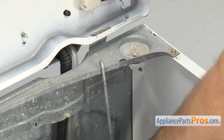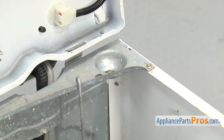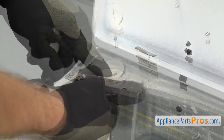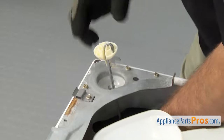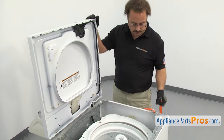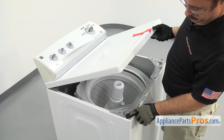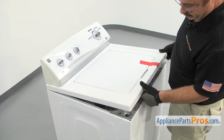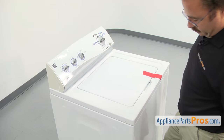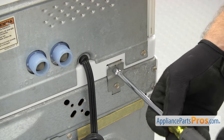On the rear one, you want to hook the rod onto the frame right here because the tub has to be supported when we lay the washer on its back. Now we're going to lower the top down. We're going to take the lanyard out, then you can lower it down. As you lower it down, you want to make sure that these tabs here go into the slots in the top. Then you can pull it forward so it drops down and push it back to lock it in. Once you have it locked in, we can go around back. We're going to use a quarter inch nut driver to put in just one of the screws that hold the top to the hinges so that when we lay the washer down, it's more secure.